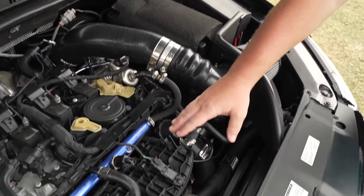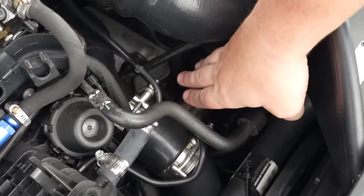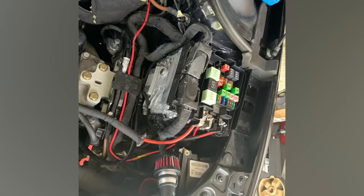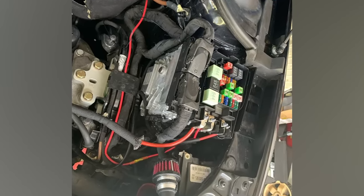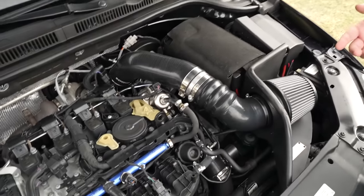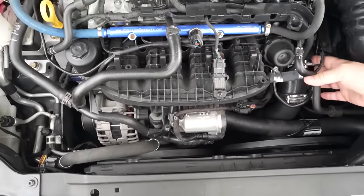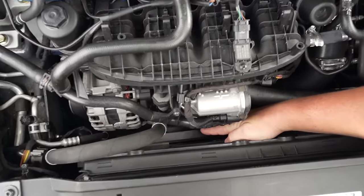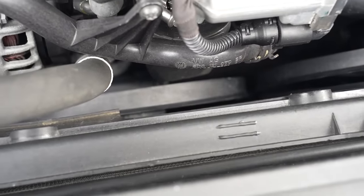With the MPI, we had to install the MPI on the car, and it took a lot of rewiring into the ECU harness and everything. We had to route the wire underneath the additional boost pipes here into the ECU, and I tried to do it as factory as possible. That's the main thing here, is I try to do everything as OEM as possible, so that way it comes out beautifully. One of the biggest complications was getting these boost pipes that I mentioned into the car. You guys can see how tight it is, and actually, if you play with the car enough, you can actually kiss the boost pipe there. So there's some R&D still going into this, obviously, and nothing's ever perfect when you do stuff like this, but eventually next year what I'd like to do is get the refinement into the car.